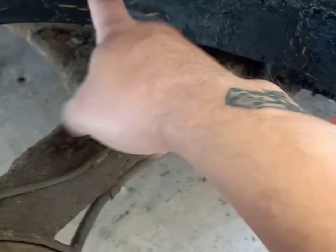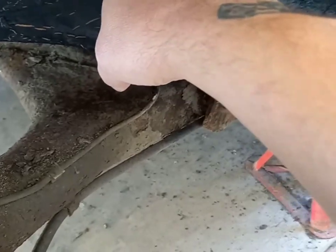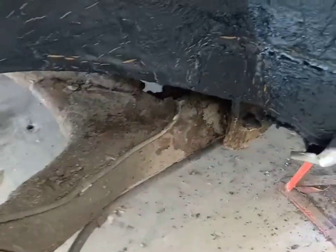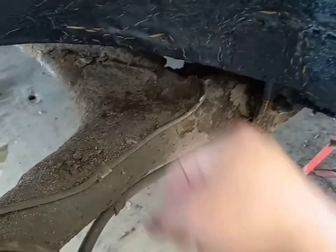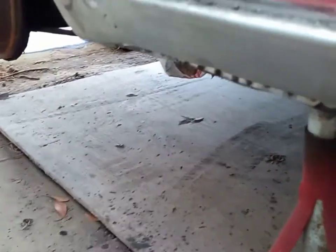I had to build a plate in here — these are where the natural holes are. I haven't been able to find the tape they originally use, so I've gone with a gaffer tape over the hole with adhesive, then seam sealed over it. I still need to go over it with underseal. It's the best I could do without the original tape. There was also a bit of rust along there that's all been treated.